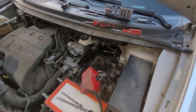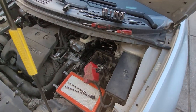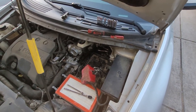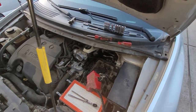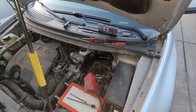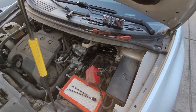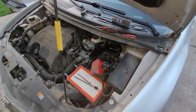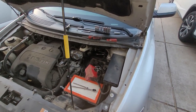Got my second line put on. Before I put the battery back in and the airbox and all that stuff, I'm going to go ahead and actually bleed the brakes for real — that way I don't end up having to do this work twice. We're going to get this thing bled out at least initially, and then we may put the battery in and do some ABS bleeding and then do a final bleed.